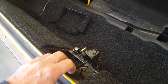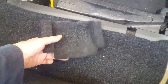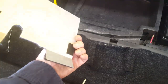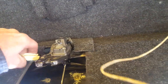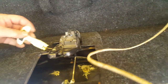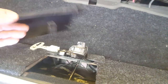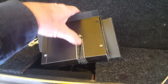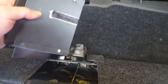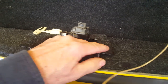Here's one of the last punch list jobs — closing up this center section of the trunk. I ended up with just two closure panels, pretty simple aluminum covered with the same carpeting material. A little bit of velcro sticks to the carpeting already in the car, so it just fits in there. There's a handle in case you lock yourself in the trunk, and this crazy-looking piece is velcroed on the top edge, fitting down behind with a large clearance hole, then covered with rug material leaving just a small slot for the rod that actuates the lock mechanism with the key on the outside.